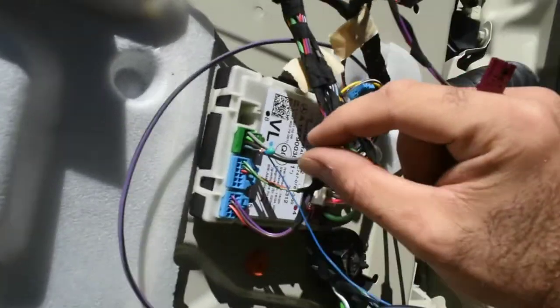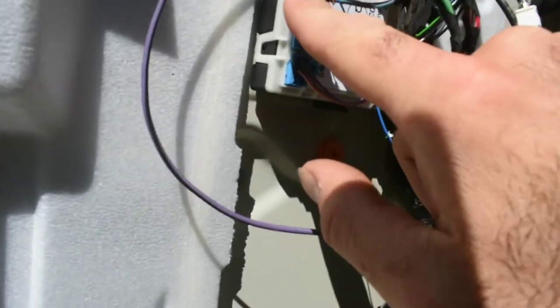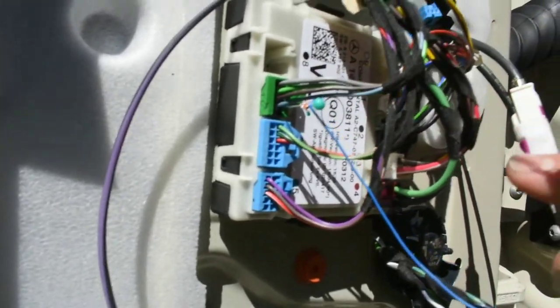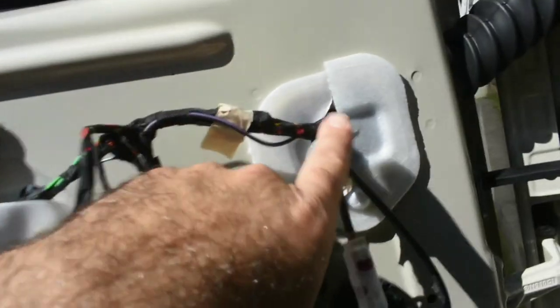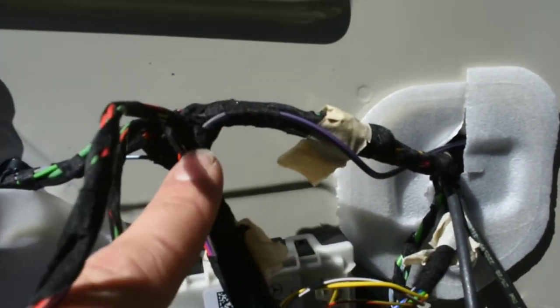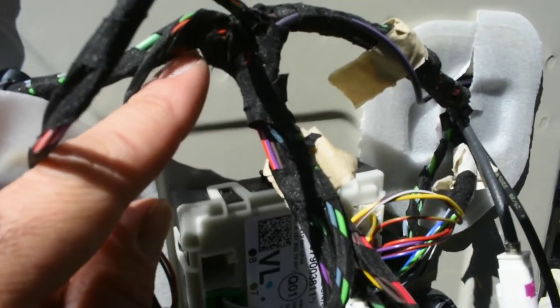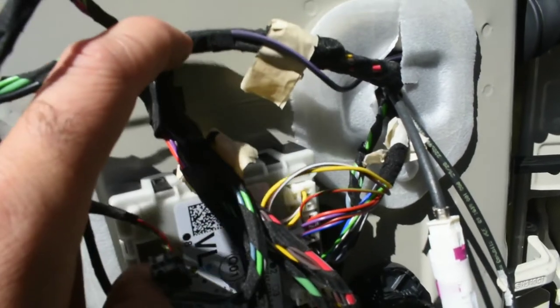On the driver's side, you're looking for the same thing. It's not in the same position, but it is still a green connector with the same color wires — gray, green, brown, and blue. The blue wire is your door open signal. Here's a final look at the driver's door wiring situation. This is the purple wire with the black stripe, and I bundled it up in the harness. They include some posi-lock connectors. I just cut the blue wire, stripped both ends, inserted both pieces into one side of the connector, and then the purple wire into the other side.